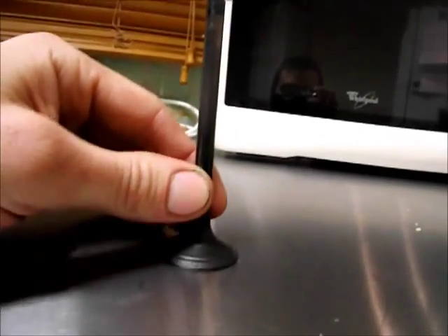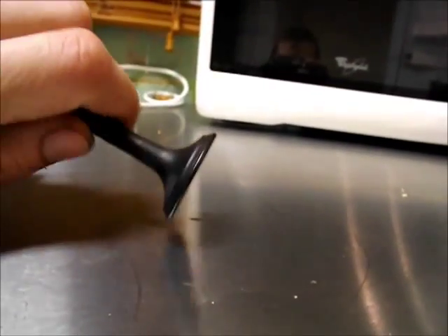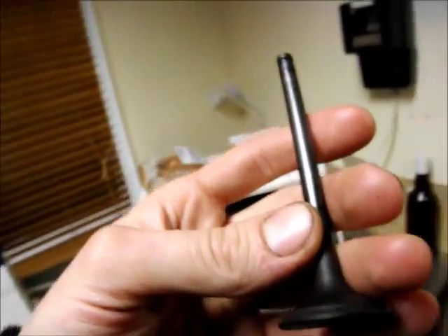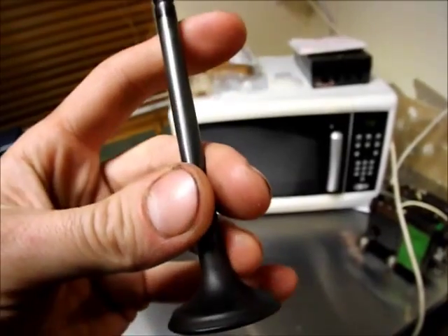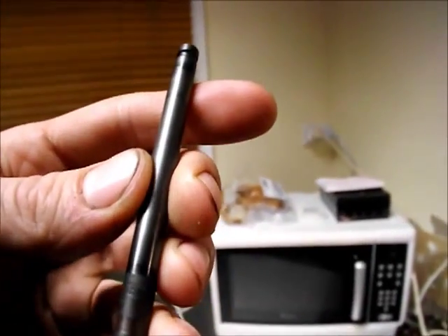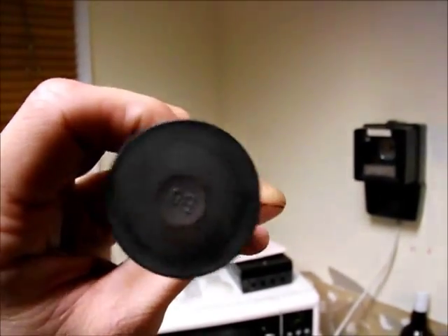Well good day everyone — this is the conclusion to the video I shot about the Laser. Mazda B5 motor I believe. This is the exhaust valve from number 2 cylinder, and it's obviously been very hot. This valve stem is blue — like it's gone a really dark colour, really dark blue. That says to me that this valve's been very, very hot, and it's cooked the valve stem seal. That's why it's been dumping oil in the cylinders.